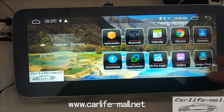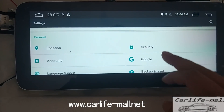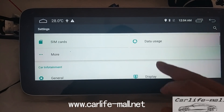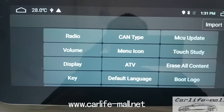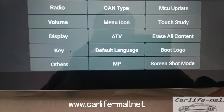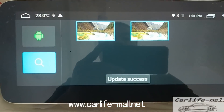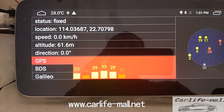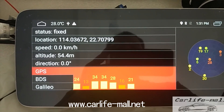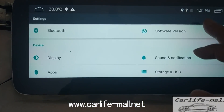Now let me tell you how to change the starting logo — I introduced this in the video. Find the software version, click here to import the new code. Then go here and find Boot Logo, click, choose the resolution, click Update. GPS time is now correct and GPS is fixed — works fine. GPS chip — no problems. For the starting movie, it uses the same code.